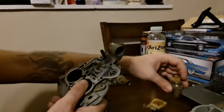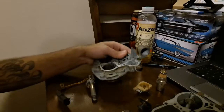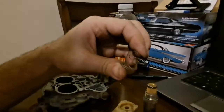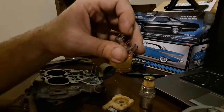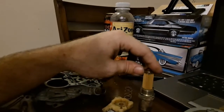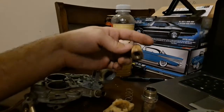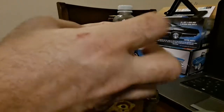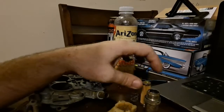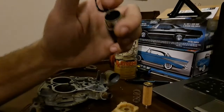After pulling the fuel filter housing out and the fuel filter spring out, this is now ready to be boiled. This spring is pretty simple to lose — do not lose it. This is the spring that goes in behind the fuel filter. Every time the fuel filter gets changed on these it seems like this gets lost. When it does, the fuel filter just sits in there and the fuel rushes around it; you want the fuel to go through the hole and out of the filter material and into the carburetor. The housing has a new ring in the kit but the housing can be boiled.